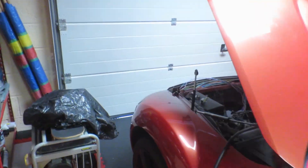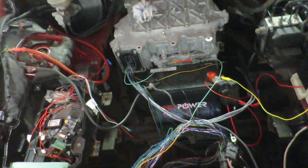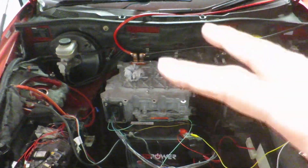Coming over to the car — you'll already know that I had the inverter and motor installed — but I've done lots of other stuff, you can see a ton of cabling here now. I've just rested a 12-volt battery in, so that's brought the car back to life. Getting the car back to life has been quite entertaining: the battery was flat, then my earth was rubbish, then the power steering didn't work — again another earthing issue because I'd ripped all this stuff out — so lots of wires were just loose and I've had to make new earths for everything.